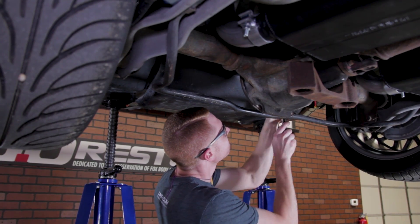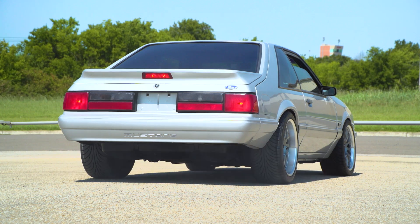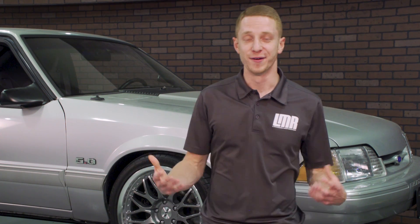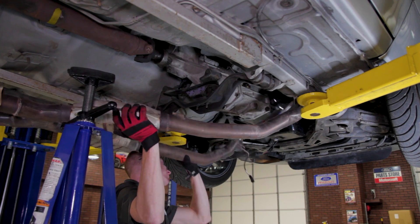Once all that was sorted and the tank was reinstalled, I fired the car up, gave it a few revs, and finally the fuel pressure issue was solved. Little did I know there was going to be a butt connector in the supply line of the fuel pump bracket, so in all reality the FMU and the T-Rex could have stayed.